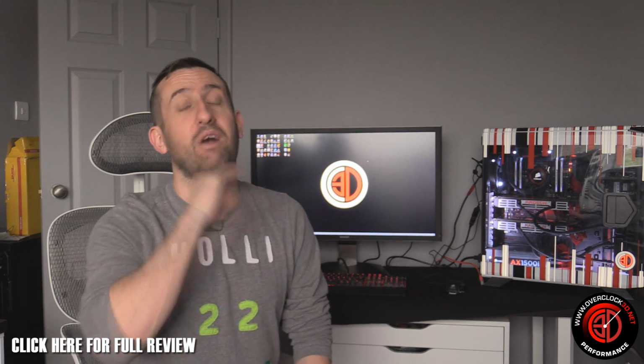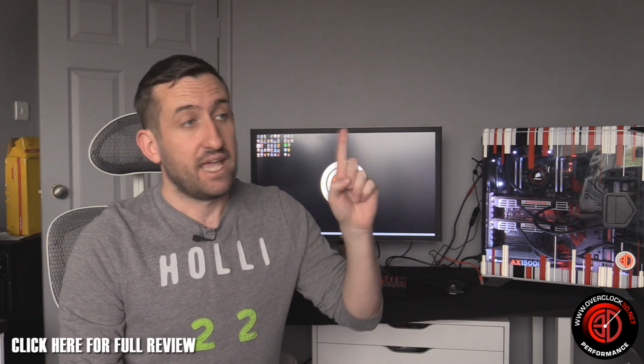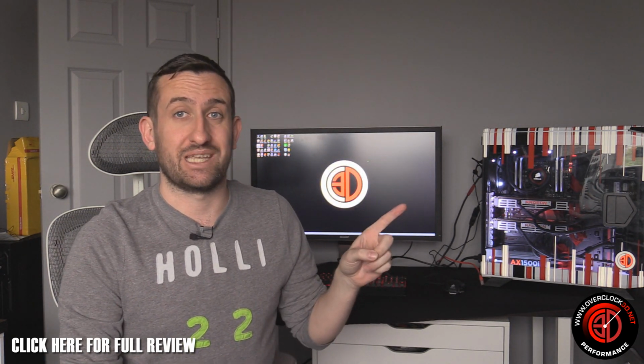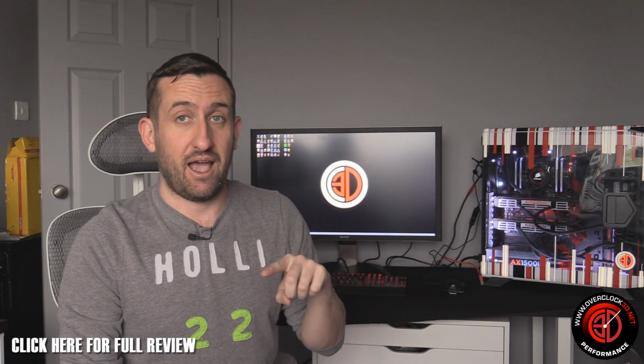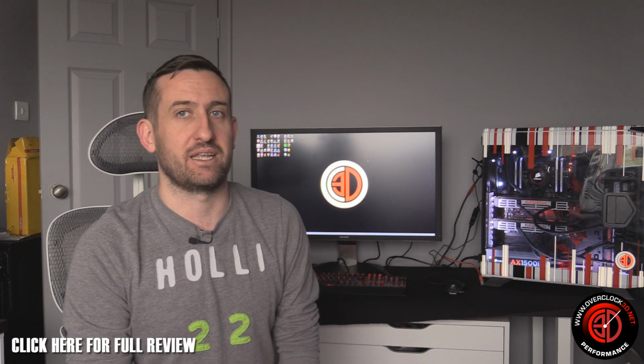I had to pick my jaw up when I saw 1350 watts. Oh, and I forgot to say, in 2560 by 1440, that was 1250 watts. So that extra resolution added 100 watts to the power draw. Just in case you think, oh, I'm going to get a bigger monitor, it's not going to make any difference.